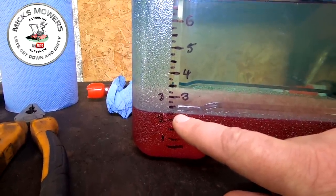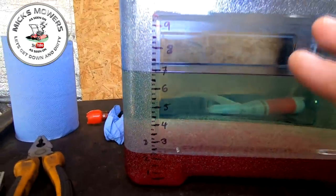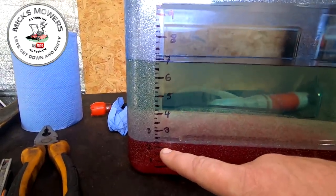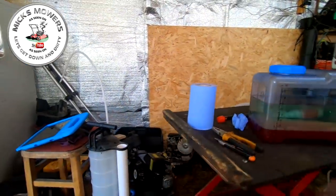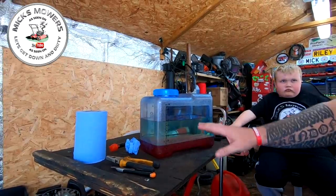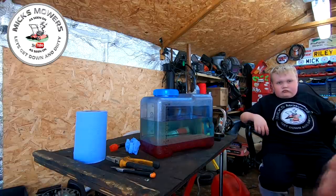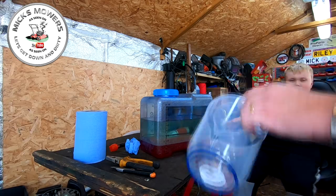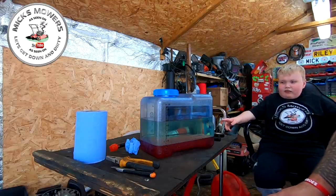We've gone up to just over a quarter litre of extra water and ethanol. So we still have the same total amount of product but we've lost a little bit of fuel volume — which is actually your ethanol. The ethanol has now been separated from your fuel. The next thing to do is remove the two products. Without the ideal container this is going to be a bit difficult, so I recommend using a few jugs — that way you can pour out exactly what you want and discard what you don't.